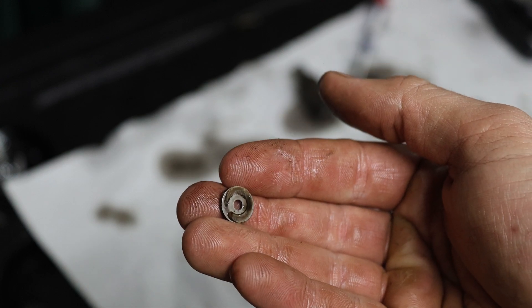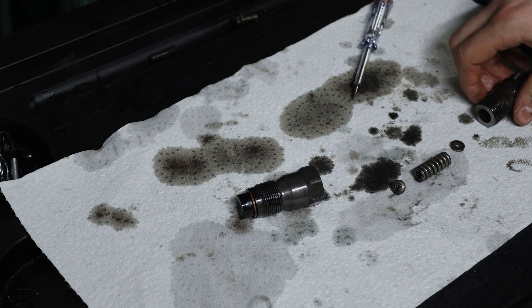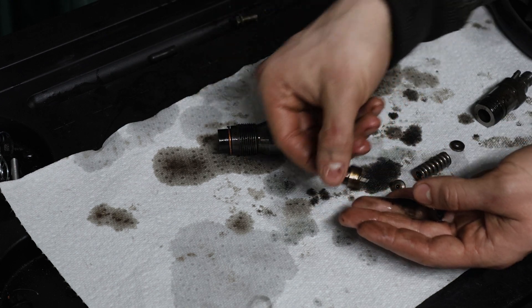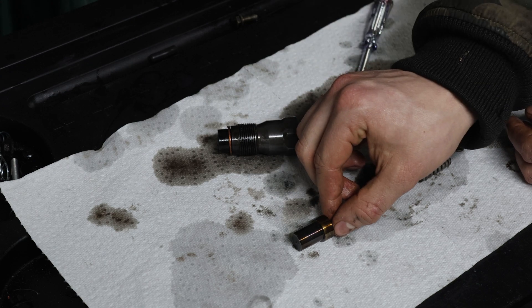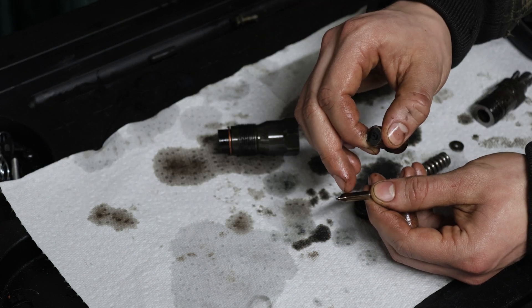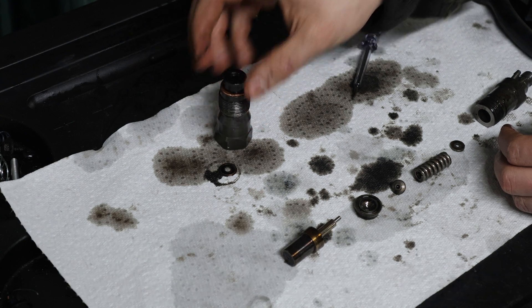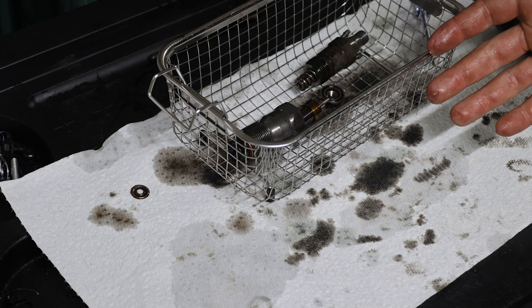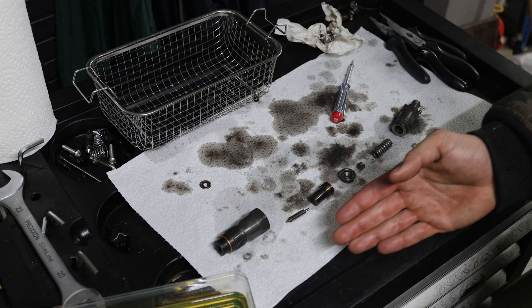This is the tiny shim. These are precision machines and you cannot just replace them with a normal shim. The top part is now empty, and on the bottom part you can just slide out the nozzle. The nozzle sits here, and inside it you have the actual nozzle with a needle — make sure not to let this drop because it will distort. There is another shim inside which is just a sealing ring. The injector is now fully disassembled. Now put it in the ultrasonic cleaner basket.